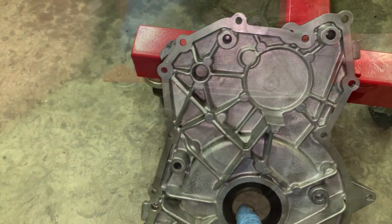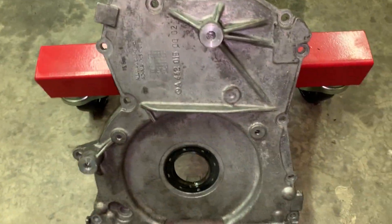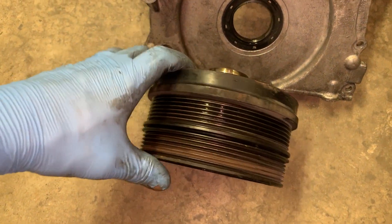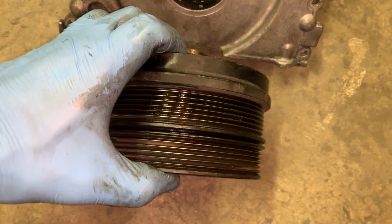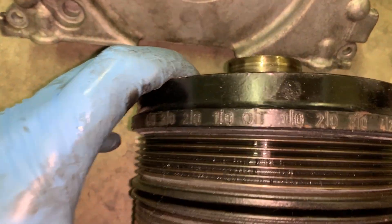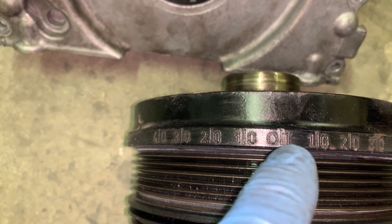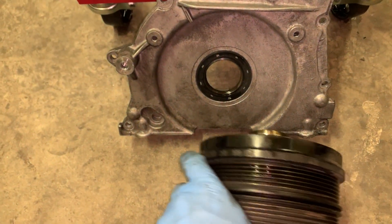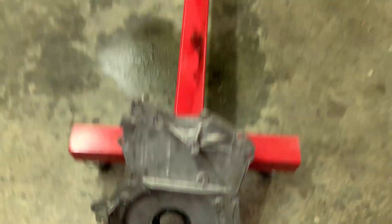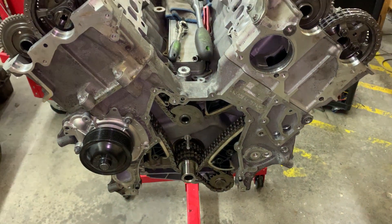This mark on the cover and the numbers on the crankshaft pulley — here are the numbers. This is the so-called zero-degree or upper dead point, so everything must line up in order to get the correct timing and perfect ignition.